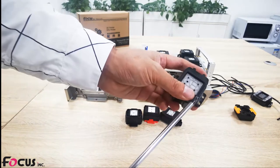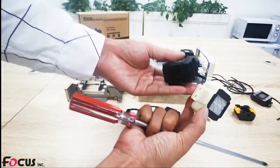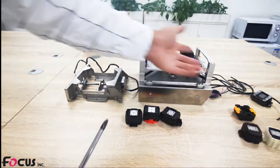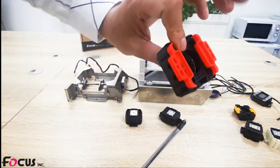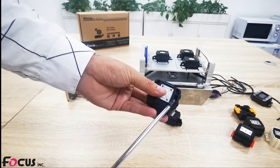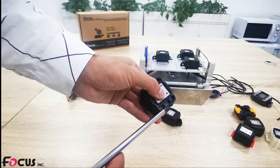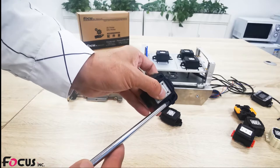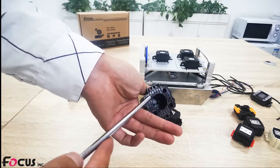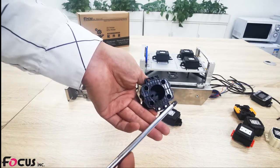We check these remaining caps. Some are just the same design with a different color frame — everything else is the same, still hard to align and still easy to leak ink. Another variant has the same design in different colors. The waste ink easily flushes to this hole position, and when full it flows to the edge and out from the bottom, potentially damaging electronic spare parts like sensors and motors. Not good.